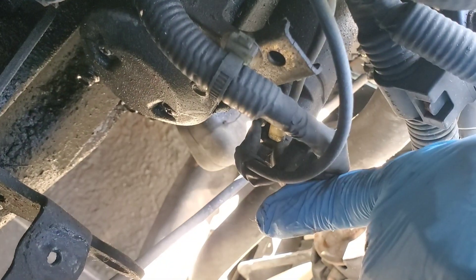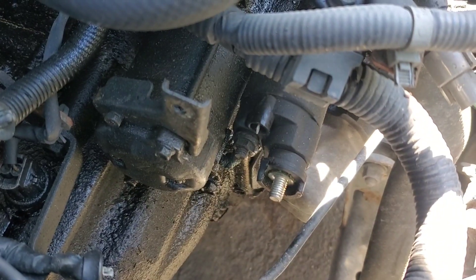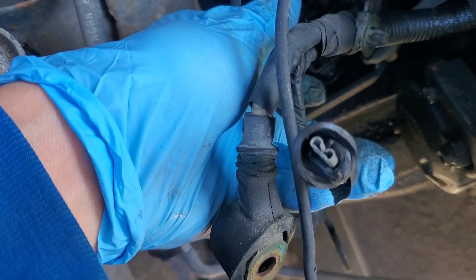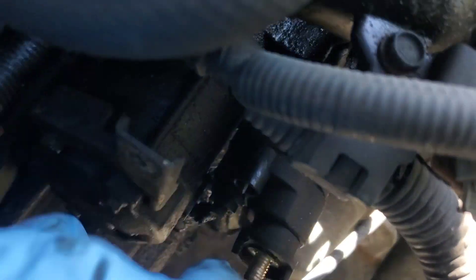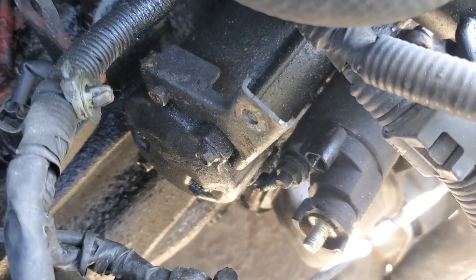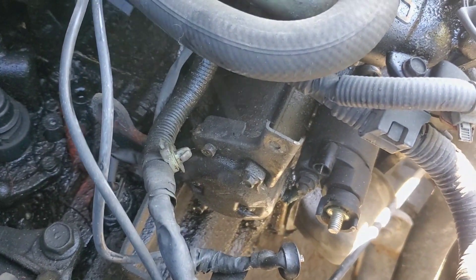This nut right here is going to be either a 10 or a 12, most likely. It might be a 13, but there's a nut under here — we're going to take that off now. I did get the nut off; it ended up being a 12mm. It's right inside here, so that's what connects to that. And then this part here literally just pulls out — that's right here on this connector on the starter. Now we're going to go ahead and locate the bolts, which I honestly can't see. So I'm going to take a look at the new starter and see where the bolts are, and then we'll move on from there.